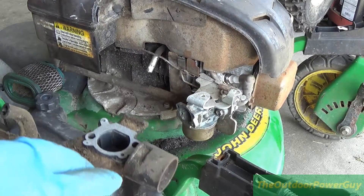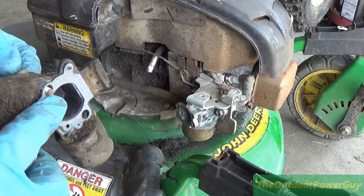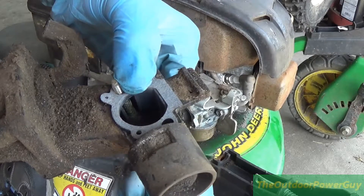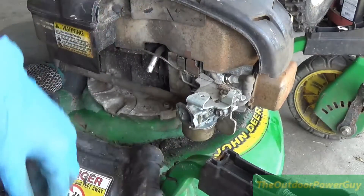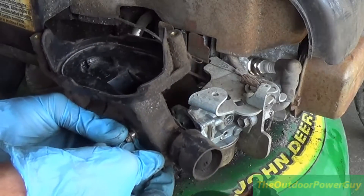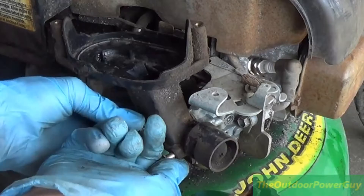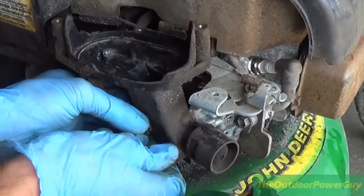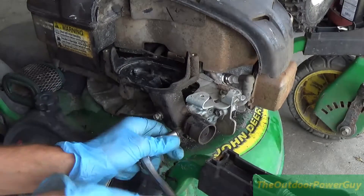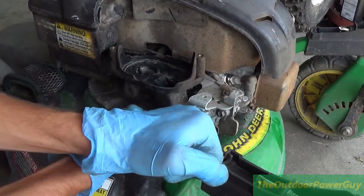You want to line this gasket up and put the bolt right through the gasket. Do not rip or tear the gasket — these things are not cheap, believe it or not. So make sure everything is aligned properly. Next, we are going to align the air box to the carburetor — just get it snug and started. These here are 5/16ths. We are going to tighten this up — same thing, don't over-tighten or you will crack the plastic.